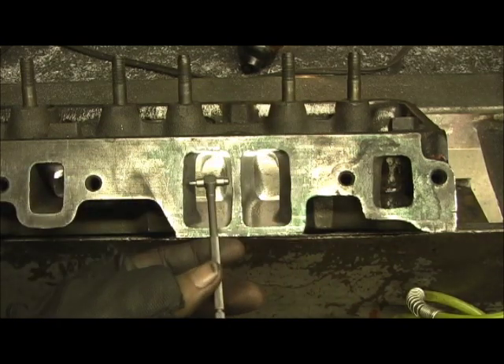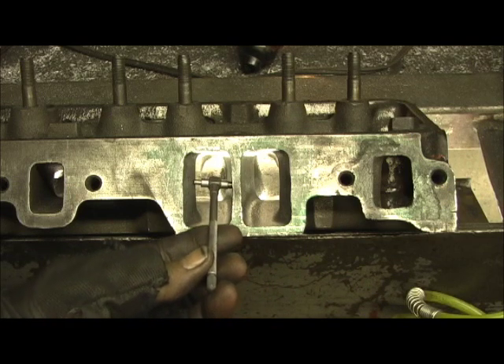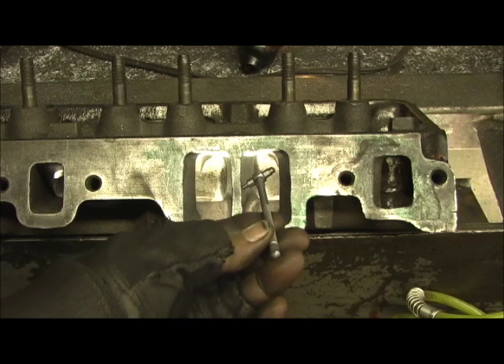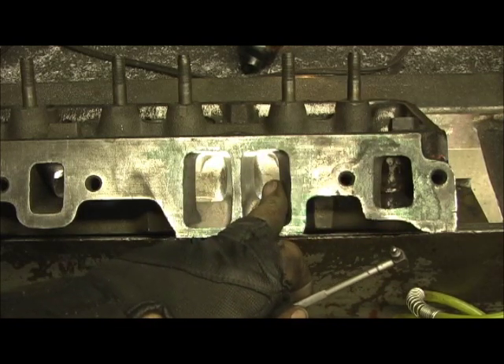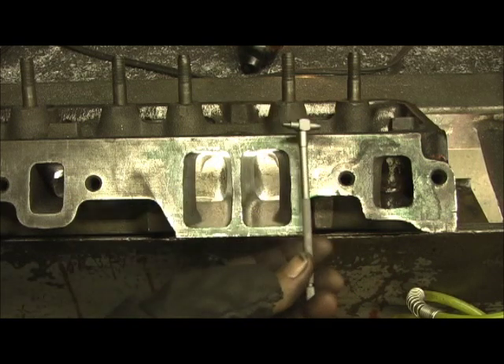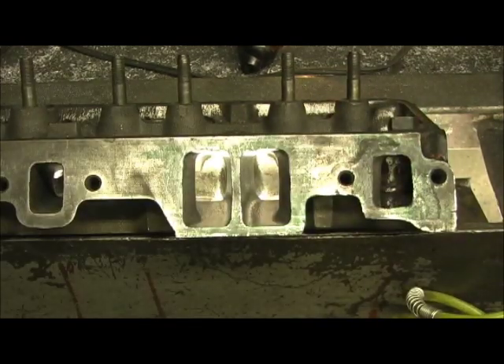I'm going to make the pushrod the same on all the ports in the head. Once again I can't go straight, so I've got to move it, let it teeter-totter back up, and make sure that it points the same. This is like a governor — it sets the velocity and the speed of the rest of the port. Unfortunately with the pushrod, that right there is also the downfall because it's got a dog leg that comes in and goes around and comes back. That's why double overhead cams work so well — it's about port area.